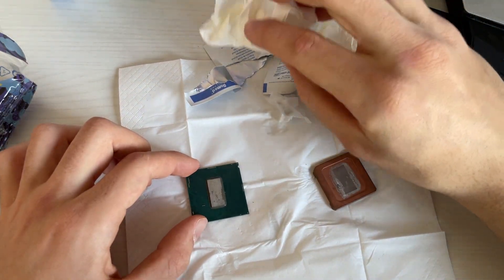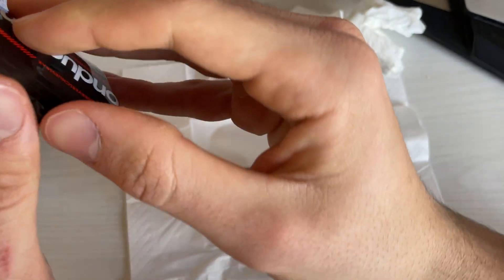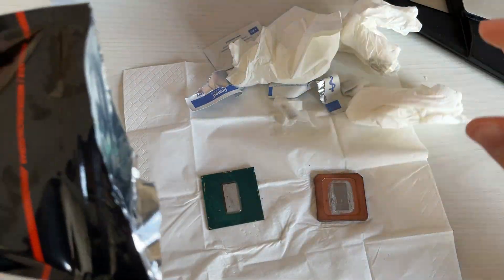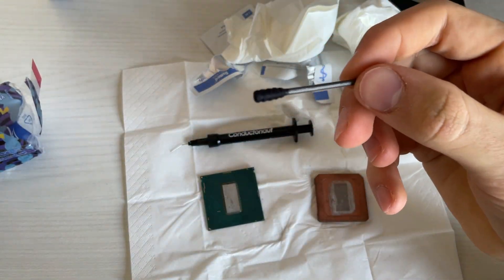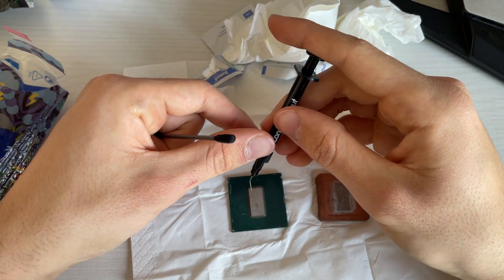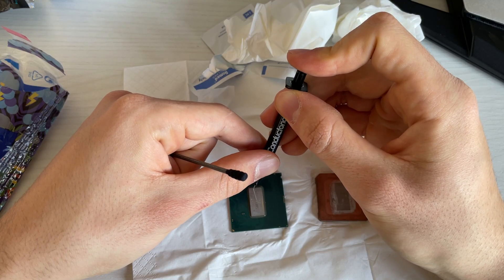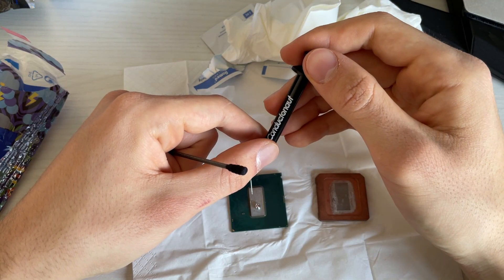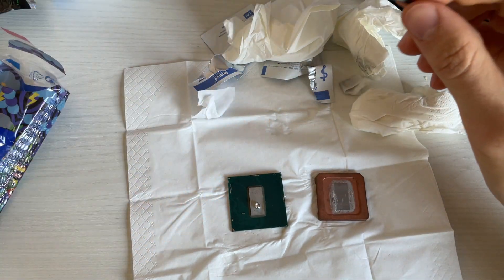As you can see, there are some liquid metal scraps on the tissue under it, so you want to swap out the tissue and then clean it off with alcohol. Before that, we're going to apply our new liquid metal again. I always keep it in a tissue because it can damage stuff if it spreads. Using a new Q-tip, we'll apply just a little bit — this is the hard part because you might spread it all over. You want to be extra gentle. It's a bit too much but we'll go with it.